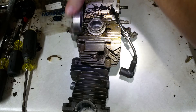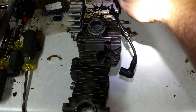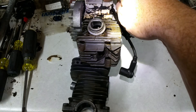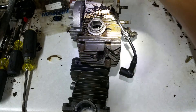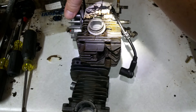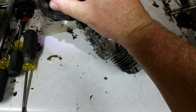The trick is that the piston is used to cover the crankcase when it's pressurized. When it opens up, it's actually causing a vacuum inside the crankcase, which draws the charge from the carburetor. Then it keeps going, closes, and the charge inside the crankcase is now compressed.